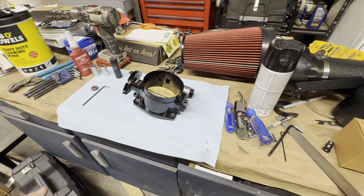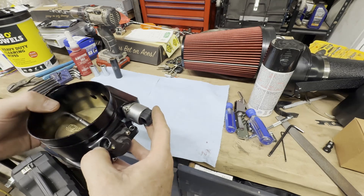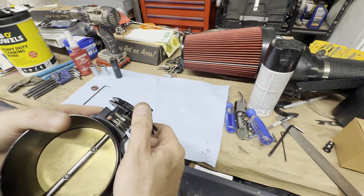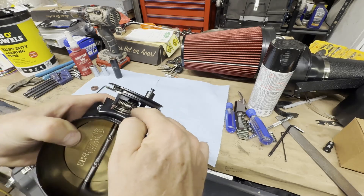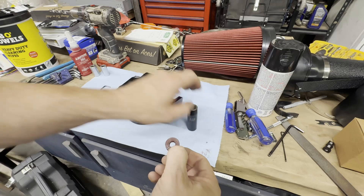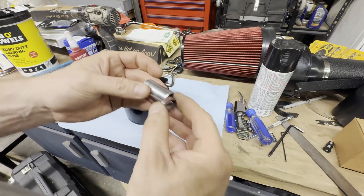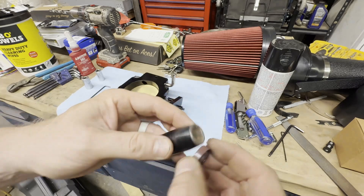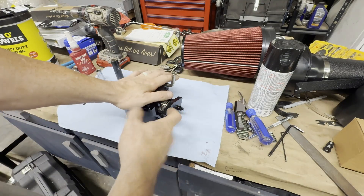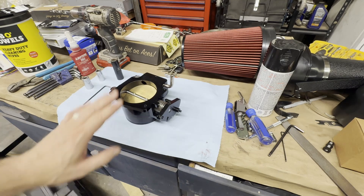Okay, we've got the throttle body over here and I'm going to show you the modifications I made. Actual GM sensors on the side for your idle air control and your throttle position sensor. Basically what we're going to do is take this lever off. We're going to count the revolutions so we know how much tension to put back on this spring. There's a three-millimeter set screw here. We're going to put this seal in there. I went through my sockets — tried a five-eighths to drive it in; it's almost the same size. I don't want to damage any part of the housing, but a 14-millimeter worked, and I've got a nine-sixteenths that's got a taper and it's just barely undersized. We'll get this put in, get the throttle body put back on, and we'll go take a look at the fuel lines and the wiring routing.